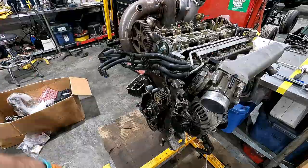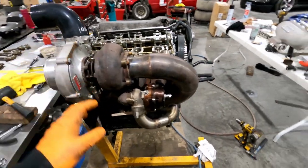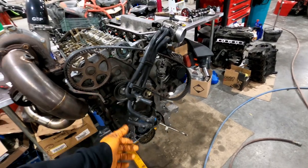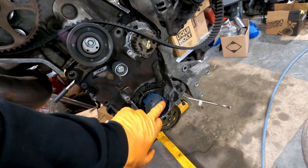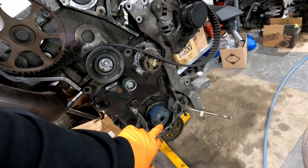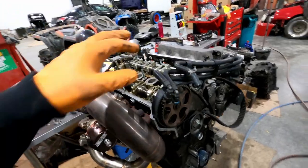I got the turbo gear on — turbo manifold wastegate. The stock downpipe bolts to this kit. This is a CTS turbo kit, so it utilizes the stock placement downpipe. For timing, I switched to the manual tensioner opposed to the hydraulic tensioner. We've got a new sprocket, and I actually pinned it as well for extra security because the keyways are junk on these. We're going to try to push for some decent power, so we want to make sure this is as secure as we can get it. We're going to get the timing all done, and start putting the valve cover and the oil pan on — then it's time to get it in the car.